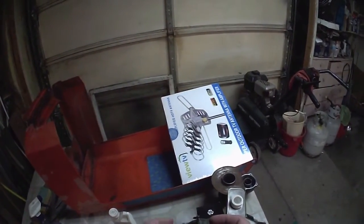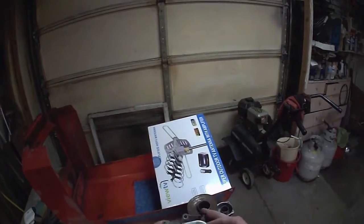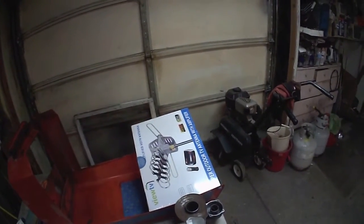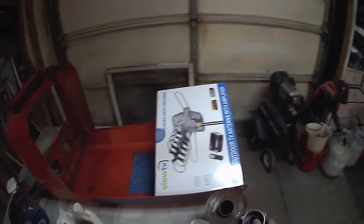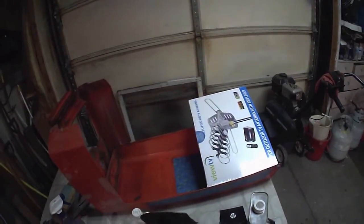So I cleaned this in the parts cleaner - the carb cleaner. Problem is it didn't really work so good. That carb cleaner had been around for about five years and it had the consistency of motor oil and smelled like gear lube. Obviously it didn't work. So I used a can of fresh carb cleaner to clean that up and get rid of the old gasket that was on here, then used a smooth surface and some real fine sandpaper to kind of flatten that out because it was cupped a little bit - it's not anymore now. Same here - just cleaned it out with carb cleaner and took a little sandpaper in there to get rid of as much of the goo as possible. Those will get cleaned up and painted.